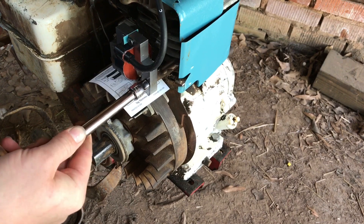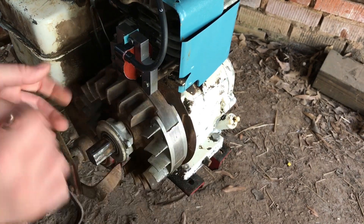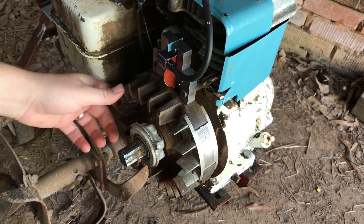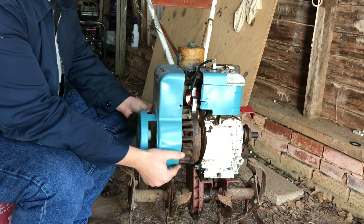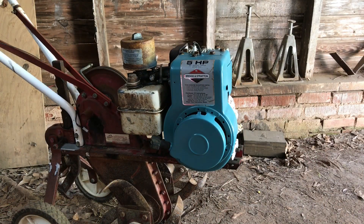Be careful not to over-tighten so you don't strip anything out — just snug it up. Then rotate the flywheel to remove the card, and turn the flywheel a few times to make sure nothing is catching or hitting. Now all that's left is to put the cover back on. When putting the cover back on, rotate that magnet right up under the magneto — if it's sitting to the side it's hard to position the cover correctly. That's all there is to upgrading your old ignition system on a Briggs and Stratton engine. Points and condenser can cause a lot of problems every year, especially on something you don't use that often — points get corroded and need cleaning. This way you eliminate that and it's much more reliable. I hope you found this video helpful — if you liked it, please give it a thumbs up and subscribe to my channel.